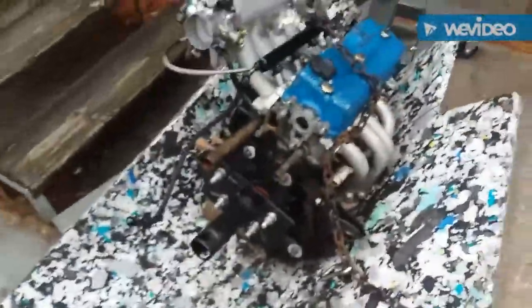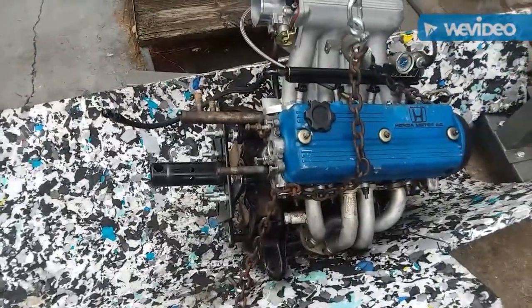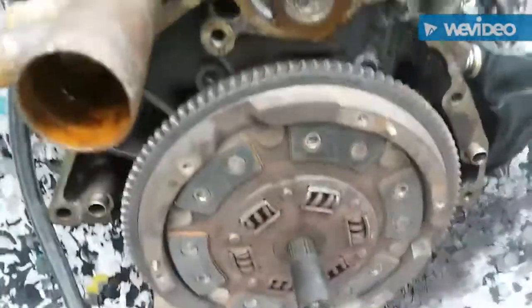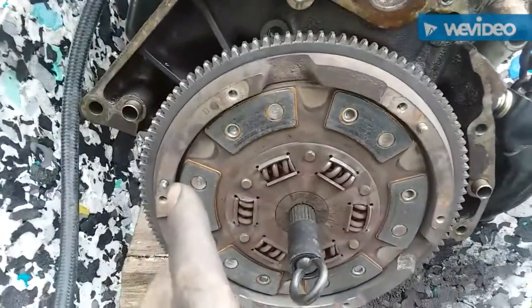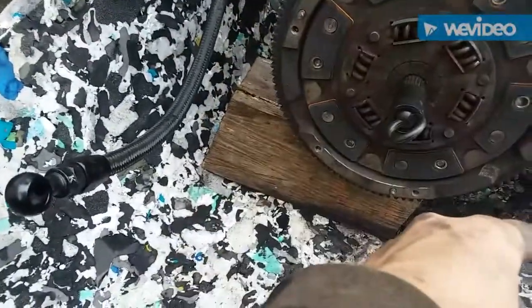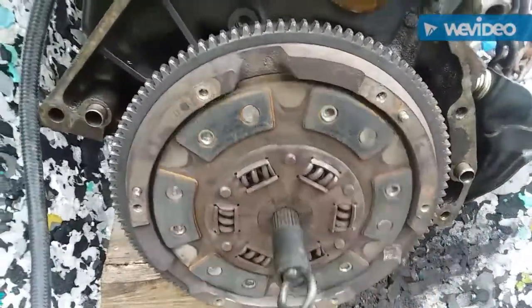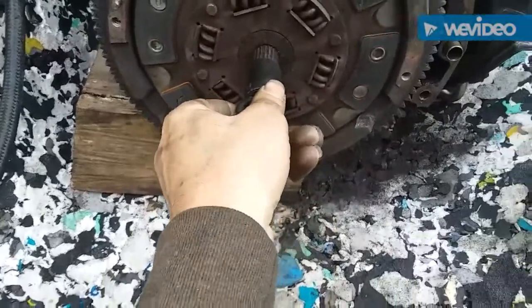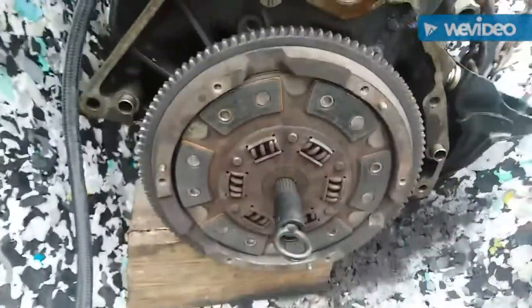Alright, we got to drop down on this padding with the block somewhat under the oil pan, which isn't on there very straight, but we'll bolt our transmission up to it and then hook that together and get it in. We got our flywheel torqued down and we got our clutch disc installed, ready to put the pressure plate on. Spec Clutch Stage 2+, you know, the 6-puck on one side and the other side's a Kevlar flat disc. We'll get that installed right here shortly.